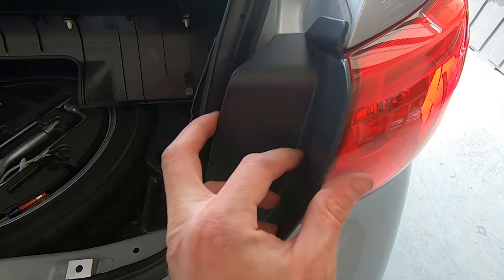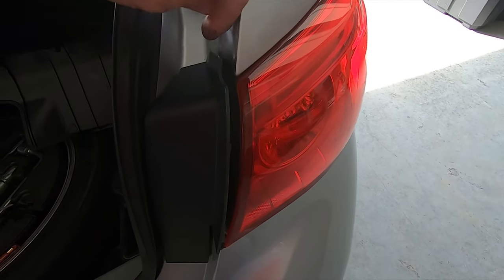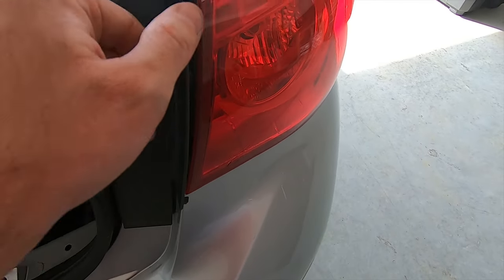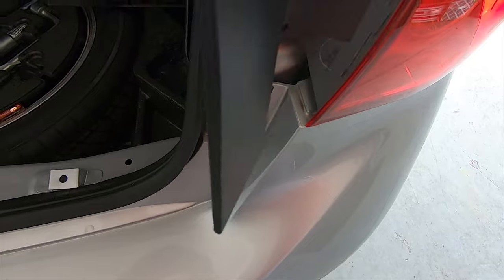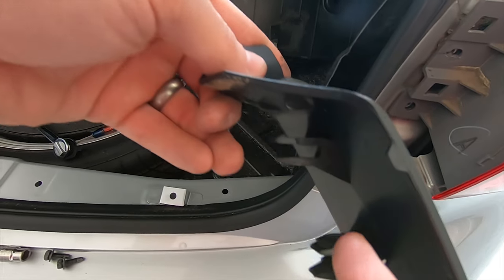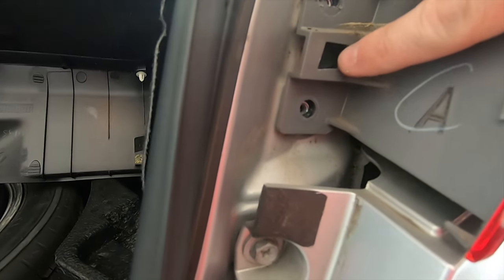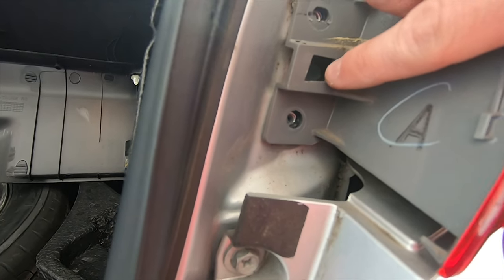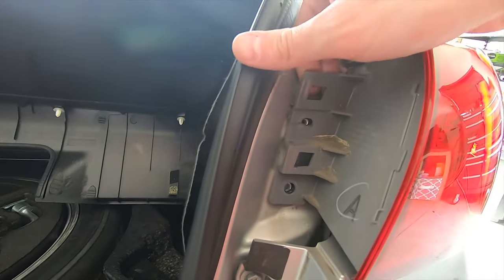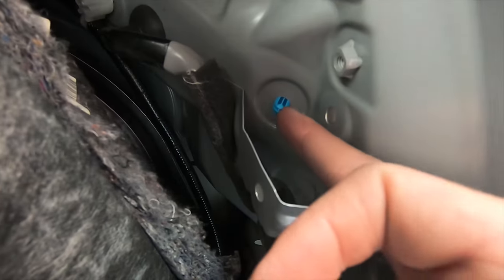I already have the wiring ran into the car on the driver's side. To do that, I had to take this panel off. First thing — so you don't break the clips — take a small flathead screwdriver into the top here and pry, which pops the pin loose. Work your way down around the edge popping all those little pins out. At the bottom, do the same thing. Once all those side pins are loose, grab it and pull straight outward and the two main clips pop out. Once that's off, there's a small hole right back there covered with clear tape where we'll run the wires through. You also need to remove two bolts holding the tail light in so you can pull the tail light out enough to slip the wires through.